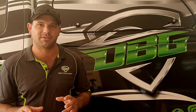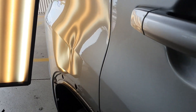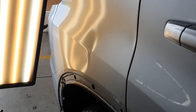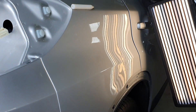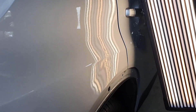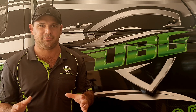The other tool we use is a reflective tool that we put on the side of the car — it's basically a light with a special lens that has lines on it. I'll read the damage through the reflection of the light. By placing the light on the side of the car, I use that reflection to show me where's high and where's low, so I know exactly where to push and where to tap down.